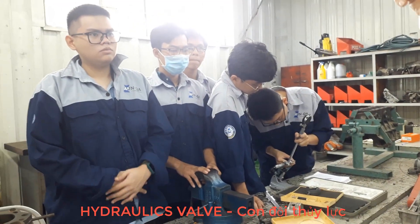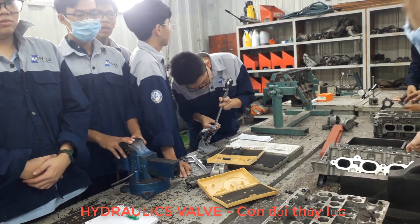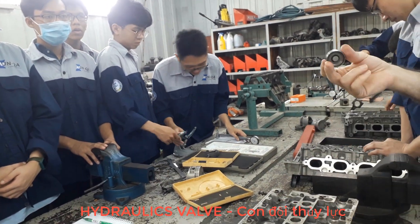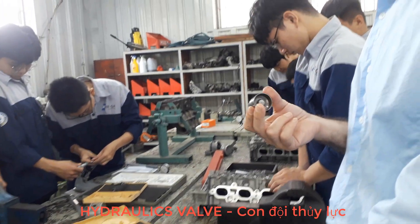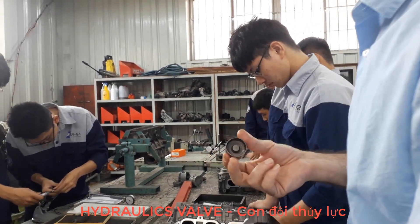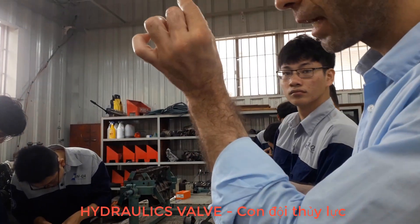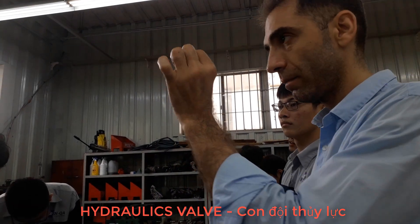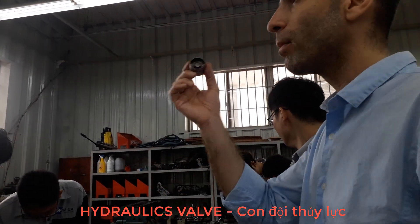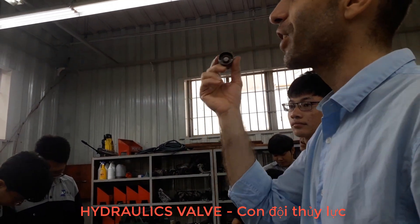This is between the camshaft and the valve. So when your engine warms up, the valve stem gets longer — it extends. So this will help to adjust. The name of this is: Automatic Hydraulic Valve Lash Adjuster. It's a very long name. Why? Because it uses oil to adjust the gap. That's why it's called Automatic Hydraulic — or Hydraulic Automatic — Lash Adjuster.